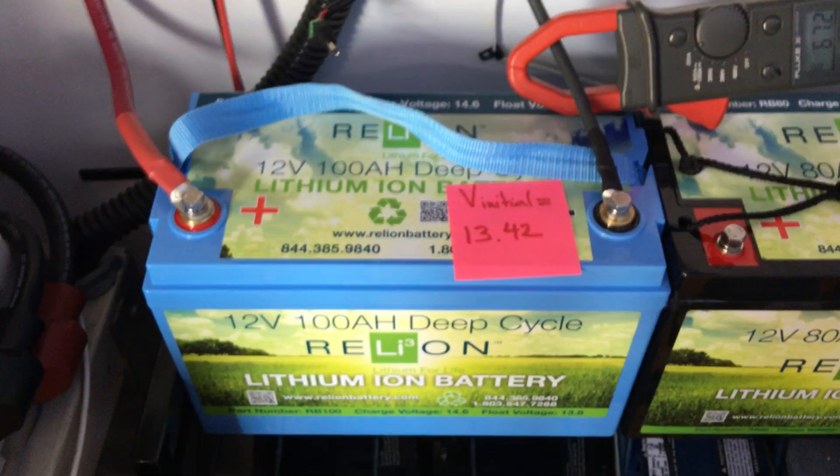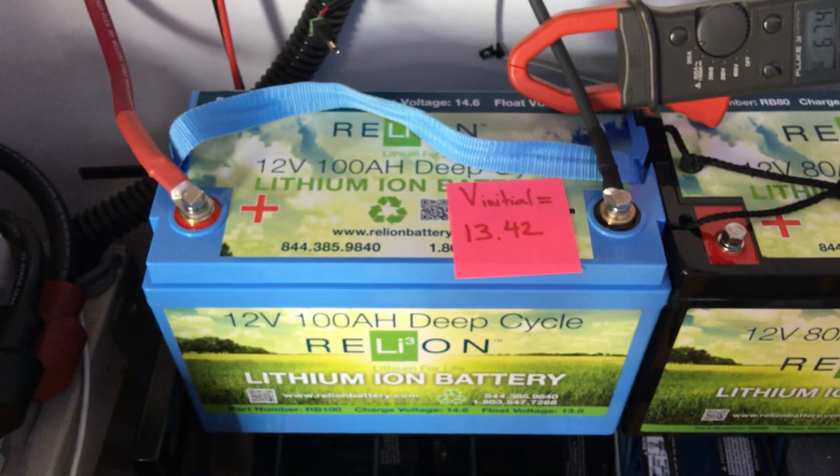My Calibs that I just took down were a 180 amp hour battery. I would say the Calibs obviously did not pull down the voltage that low. It takes a little while — with the Calibs I could pull 120 amps or 110 amps and still stay above 13.0, give or take. That might be a little optimistic, but anyway, we're already down to 12.8 at 66 amps.